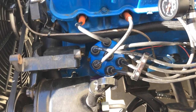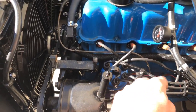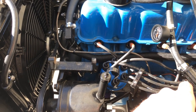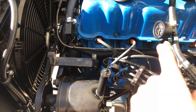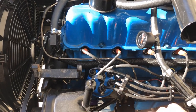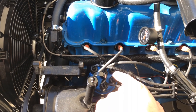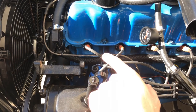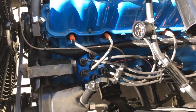That was stupid of them. It'll run fine like this because you've just switched the positions of everything 180 degrees, so it's still the right firing order — it's just back to front now. So I'm going to flip that around when I set this up. It's just a quick little mistake that they made that I caught.